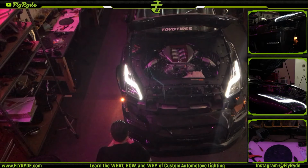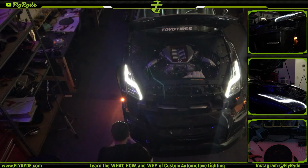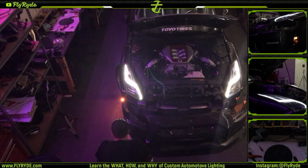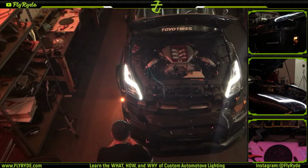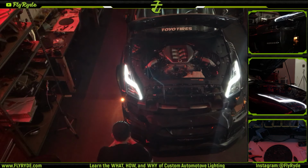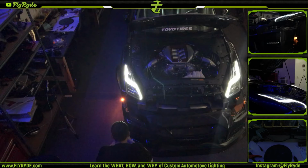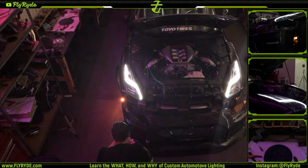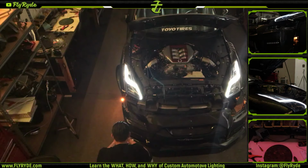Question time, question time. Let's see, off topic. Hey Chris, how do you open Permatex sealed light? I mean, cut open, oh, you cut yours open, sealed it with Permatex. Just use a razor blade, dude. An oven's not gonna help you if it's sealed with Permatex. So best advice, brand new sharp razor blade. If there's any of the Permatex that's really kind of trying to peel up from the plastic, peel as much of it off as you have to. If it's on there hardcore, just cut right through it and let it keep its bond and then go back over it later.